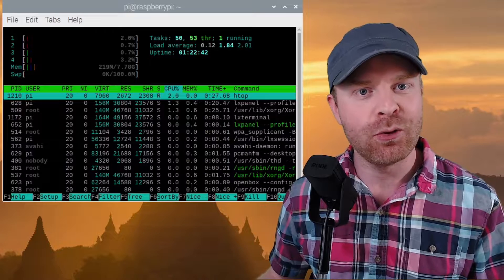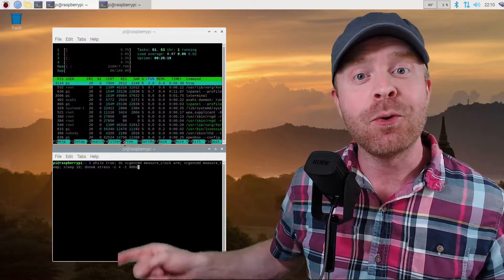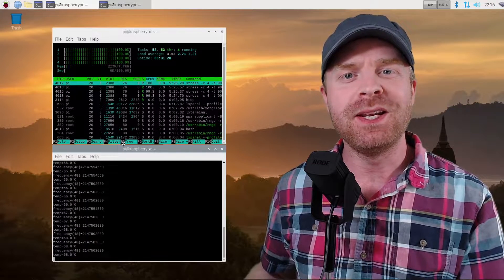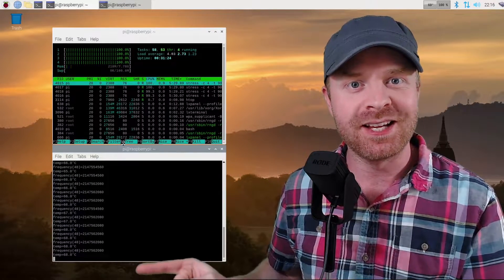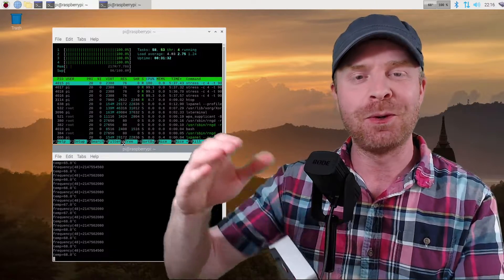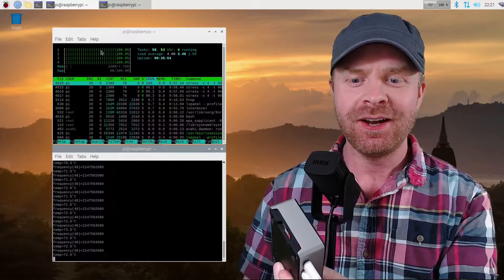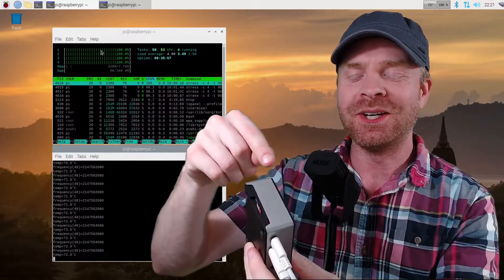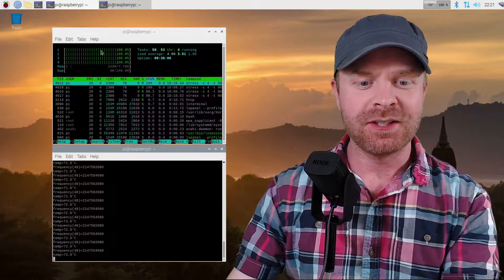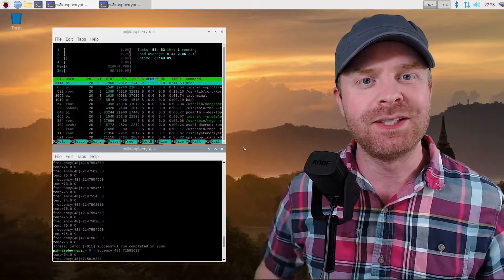Now I'm going to overclock the Raspberry Pi and perform the exact same test. I've overclocked it to 2.147 GHz. Just a few minutes into this test and we have already exceeded the temperatures from the last test — not a good sign. The Flirc Case is actually extremely hot to the touch. Temperatures have now crept over 70 degrees, and touching this Flirc Case is quite a chore — I can't really touch the metal part because it is so hot and I'm having to hold it by the two plastic pieces on the end. After about 20 minutes of testing, we reached a total of 75 degrees Celsius for the CPU temperature.